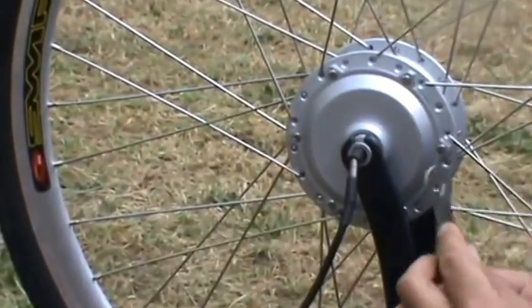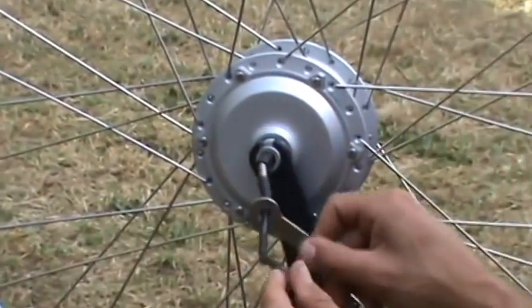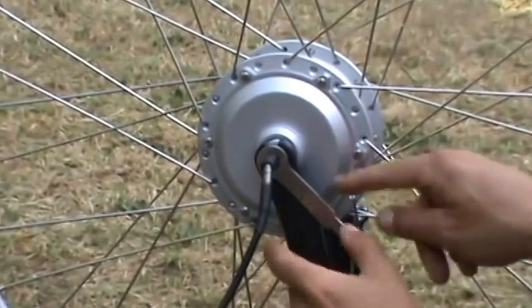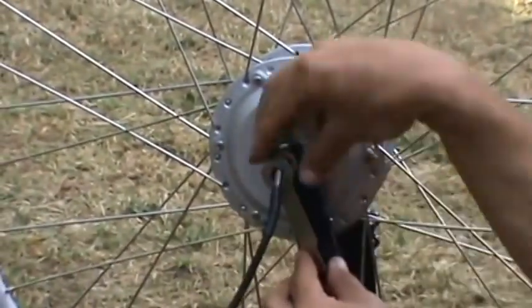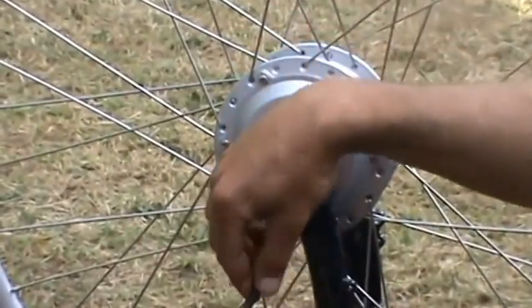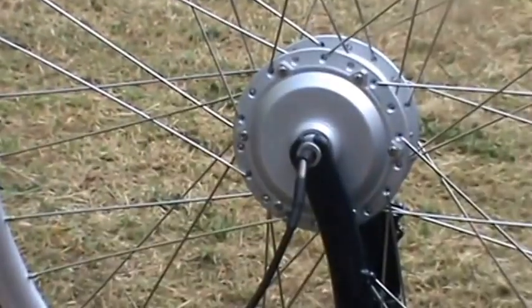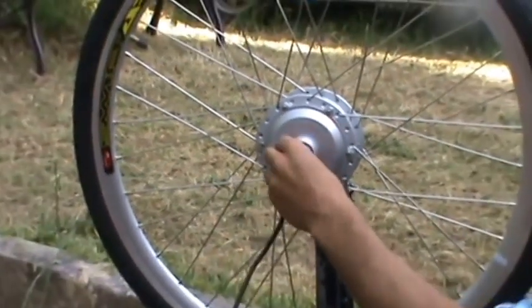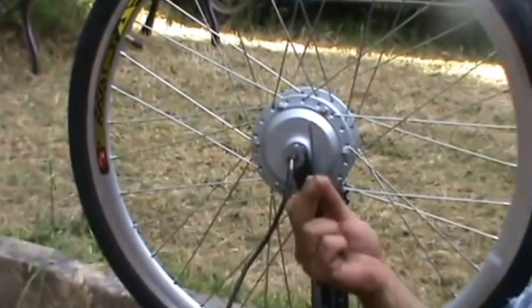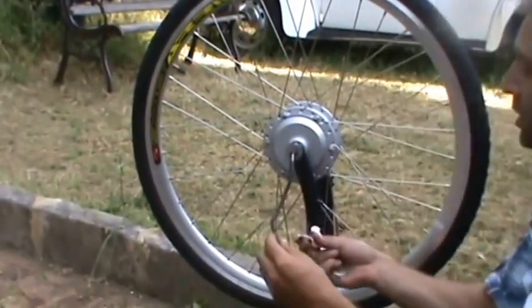We have what's called a torque bar that stops this moving in the axle. The kit will come with one of these — it's a rigid one. It's typically better, but it's not always suitable. For this bike, you can see it comes out at too much of an angle here. You really need the torque bar to align with the axle and run down the fork. So I have some other adjustable style torque bars. 90% of the time these will work. If they don't, let me know and I'll send you an adjustable one.